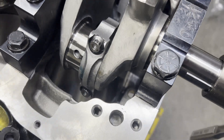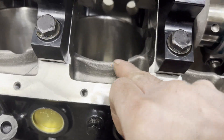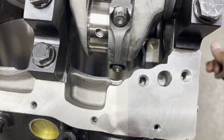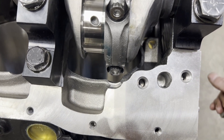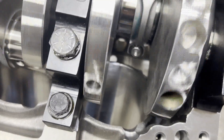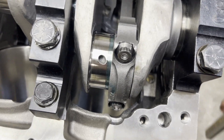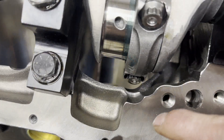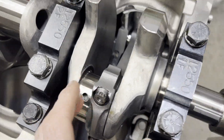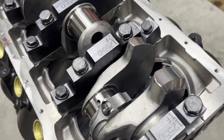If you're used to stroker kits in small block Fords, you know sometimes you have to notch the skirts — these Dart blocks are already done for you. Here's a 3.400 stroke with a 5.400 SCAT rod, and it is very far away from the block. On some big situations you can see where they grind right here to clear the oil pump boss — that's necessary on some long strokes. Good shape here, clearances check out, and I'm going to get these other pistons knocked in.